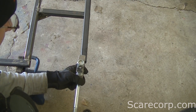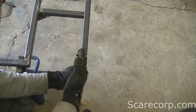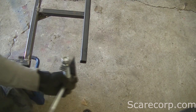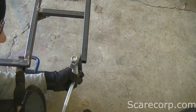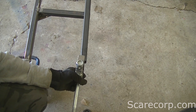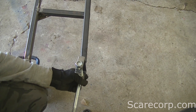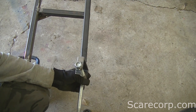When doing this part, you don't want to keep your spindles 100% vertical. You actually want to do a little bit of caster — a back caster. That way it will allow the tire to ride on there more properly and the physics will work a lot better. For how much caster, you want to go between 5 and 10 degrees back. I think I'm going to go probably around 5 degrees — not all the way to 10, just right around 5.